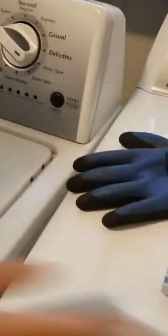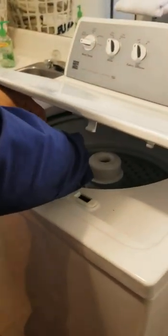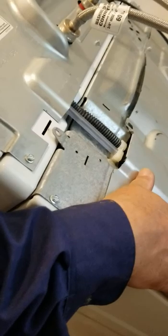We're going to turn off the agitate — there's the spin, spin, agitate — that turns it off. We're going to go back to the drain pump. I passed it. Right here with the rinse, spin, and complete — that's the drain. We're going to drain out all the water; it's going to make this thing lighter to push back into place. Then we're going to put our screws on the back — let me show you an easy way to put these screws on if you're at home.